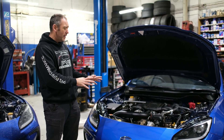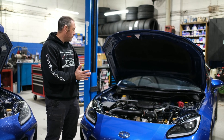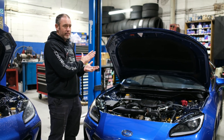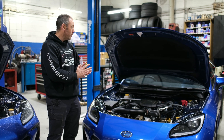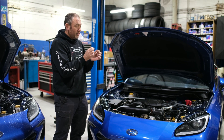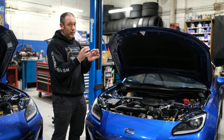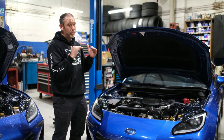It's got all the Funk gear on it — the Funk wrap, Funk beanie, all that stuff, supplied through RaceFix. We've opted to go injectors. This guy uses it as a daily but does a heap of track days. From my testing, the injectors make sense because you're pretty close on fuel with the new turbo. You can do the turbo with stock injectors, but you've got to keep your boost really low.